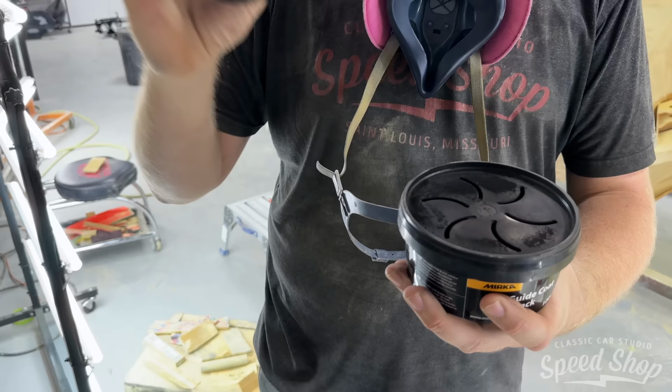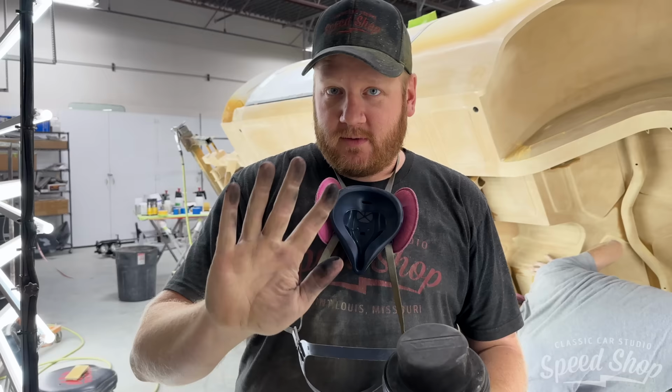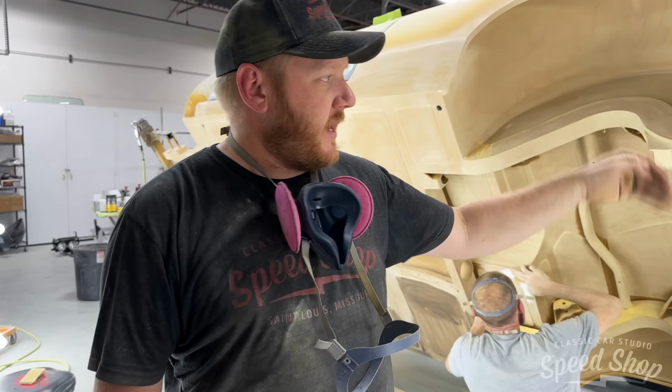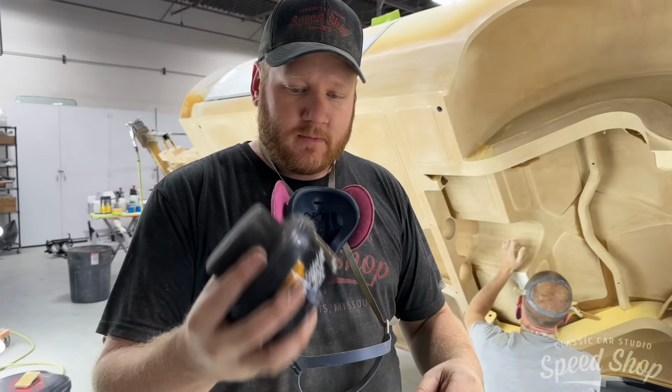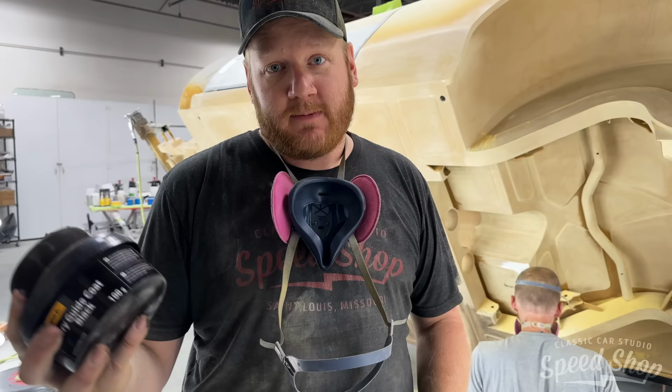Powder? Yeah. It comes out all black. Smear it on, and it gets down into all of your previous scratches. You use it as a guide. Once you're done with one grit, the guide coat will show you, and we'll go back and re-sand it with the next finer grit. Once all the guide coat's gone, you look your panel over, and pretty well all the scratches are gone. Not 100% foolproof, you always want to double check, but it's a very easy step to help make sure you get rid of 80% of your scratches right out of the gate.